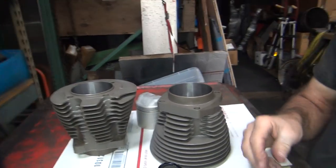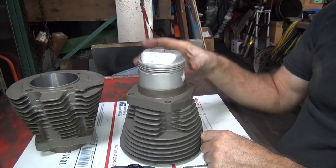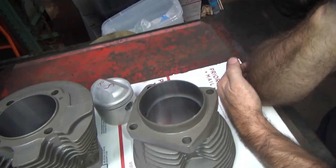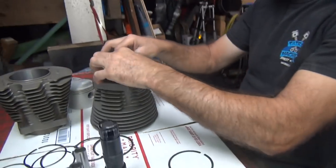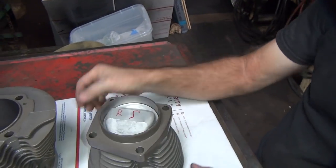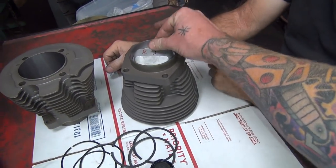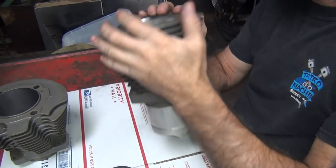How about that one? That one's pretty good. Let's do the old thumbnail test - yep, must be fat enough. We got clearance. If you lift up equally, you don't twist the ring and squeeze it together - you don't scratch the cylinder up. Which way is better? The second way. So you push them together and drop them in, push them over a little bit. Square them with this if you want. Why am I using the other side? Because that will get in the way - the dome's in the way. I'll put that one. This thing is gonna fly - I'm so excited.